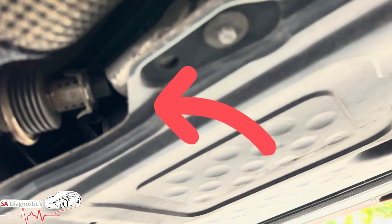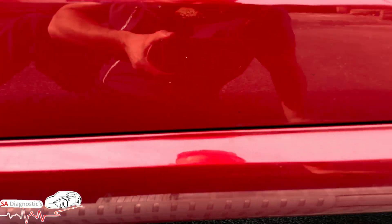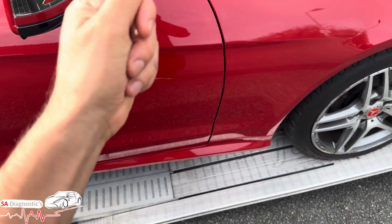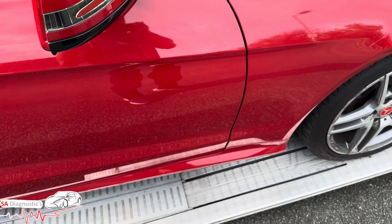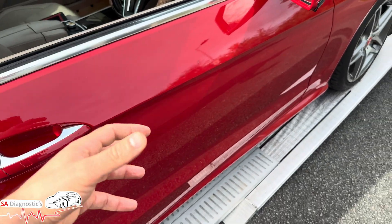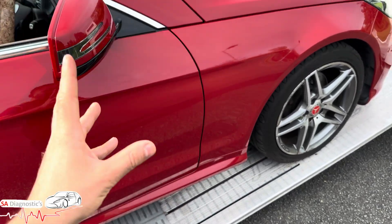What you can do is open it up, and my recommendation would be to clean it and then put it back on and see what happens. They are known for it to carbonate — there's this white buildup that kind of clogs up within it, giving the wrong reading, and hence why it says electrical fault. Clean it and put it back.